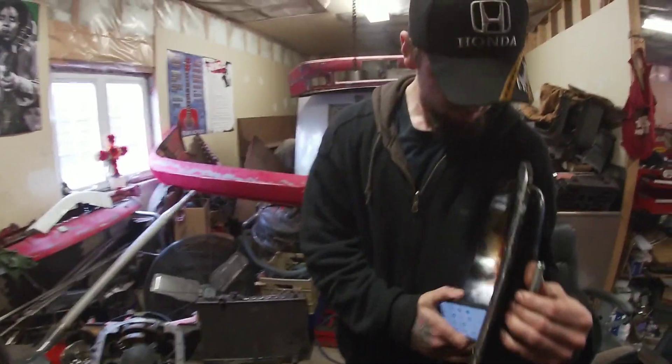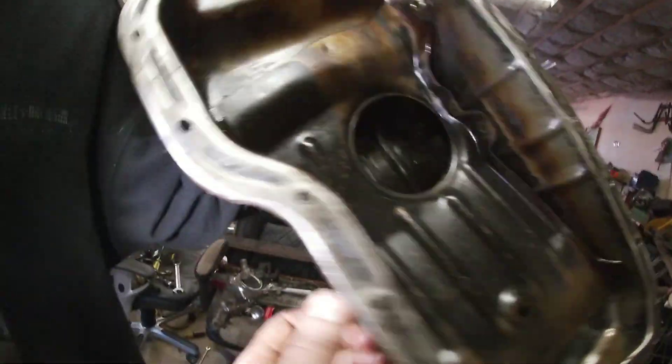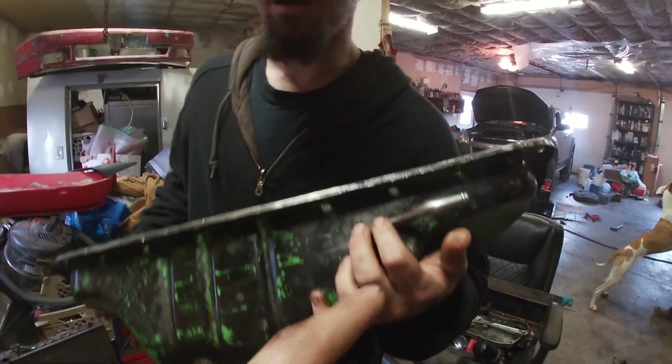When you do this mod, you'll need to do a little clearance work on the oil pan. You can see where the pan used to run right underneath — you just have to massage it gently with a ball-peen hammer. Depending on the year of your 7M, the oil cooler fittings can be in a different spot — something you've got to watch out for. This looks badass though — this is how you do your 7M oil pump mod.